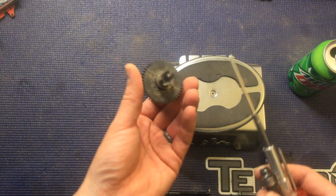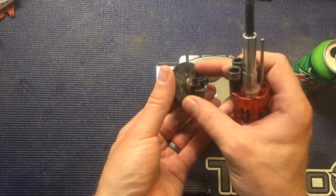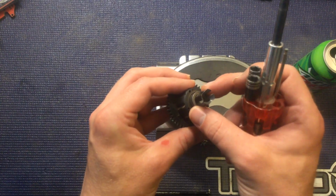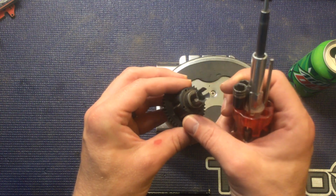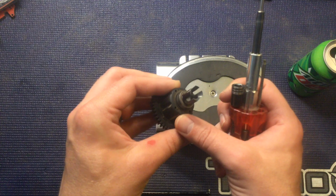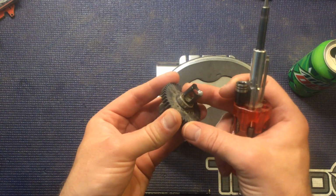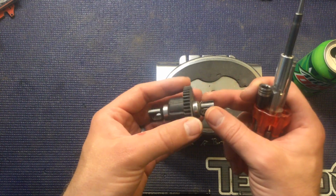As you can see, after all that time, I did have a shim in here the whole time, and then the back bearing has worked its way apart, and now all of our loose dirt glory. All the bearings do spin free, but you can see the shielding is pretty much non-existent. Front bearing is also super free spinning, so both of those are going to get changed out.